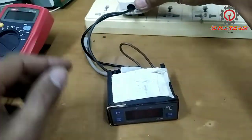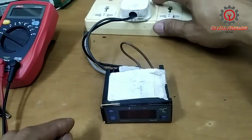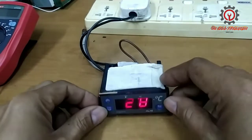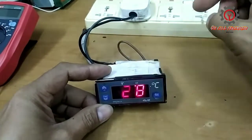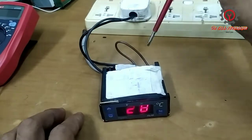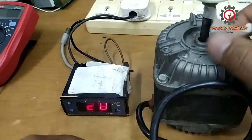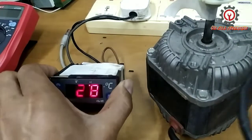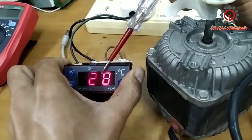Replacement done. Let's put the power supply here and power it on again. My room temperature is 28 degrees Celsius and the output light is on. Here is the E1 error fix — the load for the compressor is connected as a substitute, and the output is lit up, meaning the compressor is now activated.